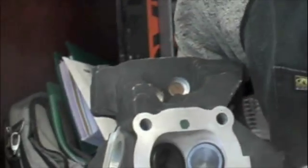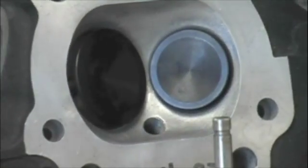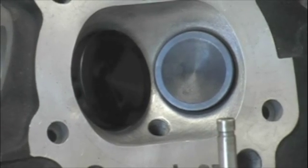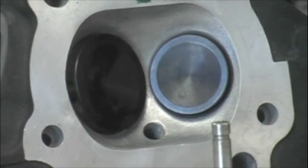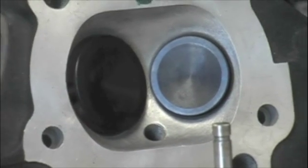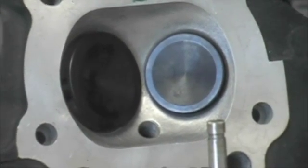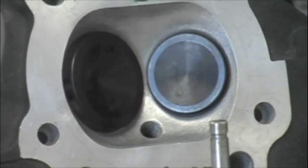If you look here, you can see that the valves are open and you see that you've got a gap there where the valves aren't going to rub or hit and make a ticking noise in your motor. So you've really got to think this out when you install bigger valves in a cylinder head and on cam choice when you try to determine TDC lift.